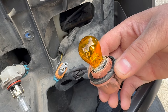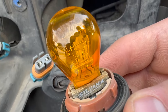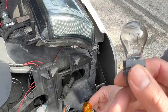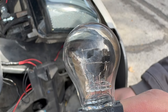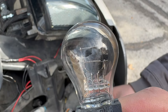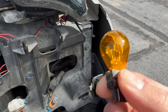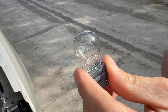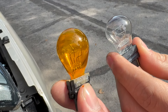All right, we've got the headlight out. Now we're messing with the bottom one. We're going to check the bulb and see. Guys, I think we found the culprit. I don't know if y'all can see the glare — kind of hard to see on this one — but there are two springs in there. See? There's a bottom one and a top one. The top one is burnt out. See how that top one's broken and the bottom one's good? See how it's connected on top and the bottom on a good bulb? And this one is not.